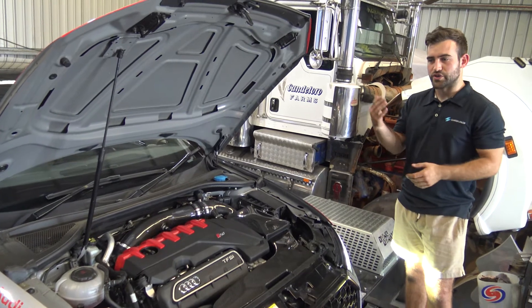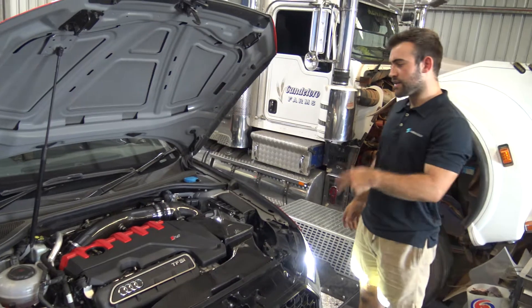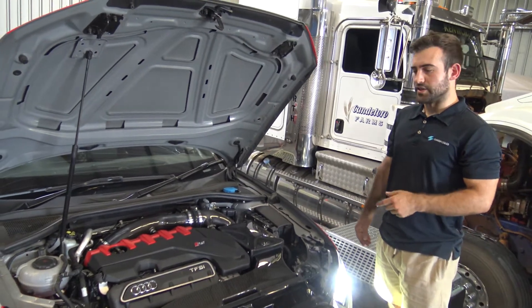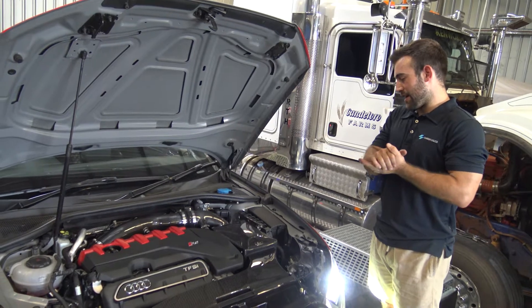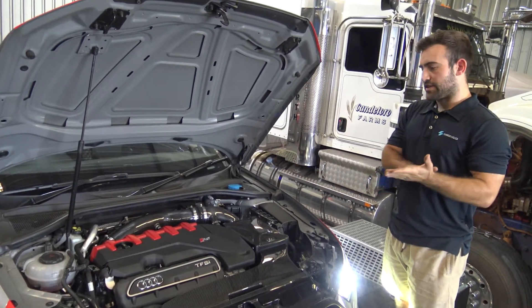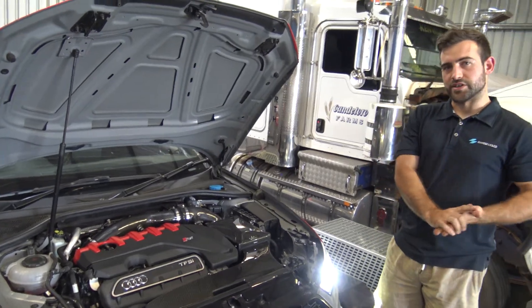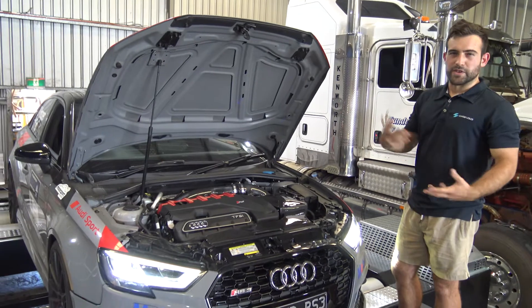The intercooler is 125% larger than stock, which is insane. We've already seen some amazing improvements — a reduction in air intake temperatures from around 70 to 85 degrees Celsius down to about 25 degrees Celsius with our intercooler. That's going to be a very positive thing for us tomorrow when this car's racing, keeping those air intake temperatures down so we don't have as much ignition correction and boost correction, and the safety system kicking in because things are getting too hot.